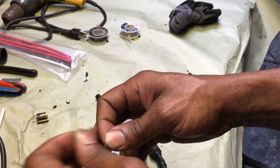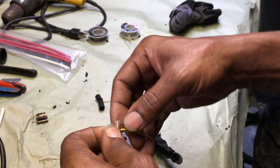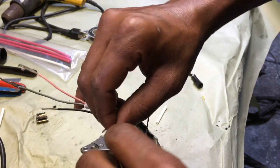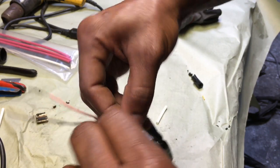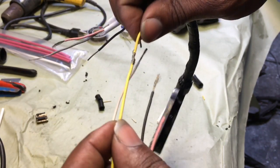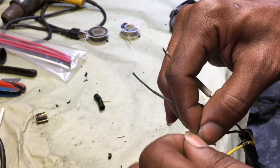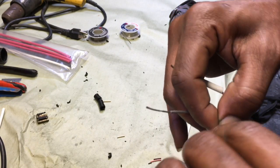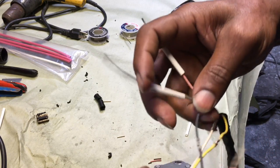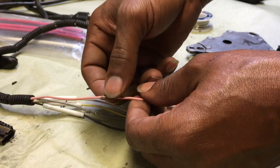Now I'm twisting my wires together. I make a physical connection by twisting my wires together, then I solder it. My personal technique: make a little cross like that, then I hold it right there and twist my left hand counterclockwise and my right hand clockwise — or vice versa — and you see it makes a very nice, strong, neat-looking joint. I do it again with the gray wire — twist it, twist it, make sure no loose ends, nothing sticking out, everything is flush and smooth. You can see I have my heat shrink tubing already on the wire.